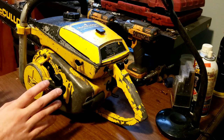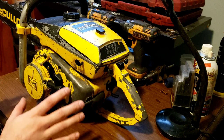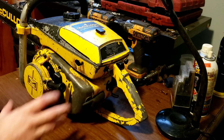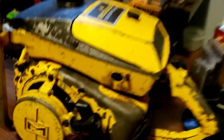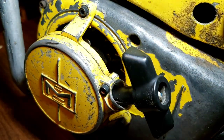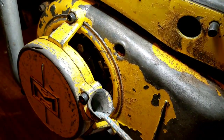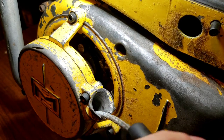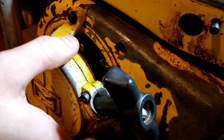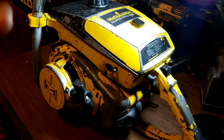In simple terms, what happens is when you shut the saw off on a chainsaw — high compression ones or ones with good compression — it comes up to the top of the compression stroke but there's not enough to overcome it, so it goes backwards. When it goes backwards, the dogs inside the starter — the pawls on the inside right here — catch on to your starter, and when it rotates backwards it catches on and wants to pull that rope and the assembly back in because of that reverse action.